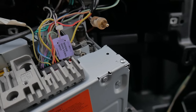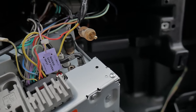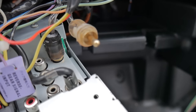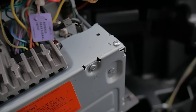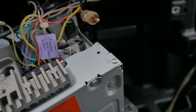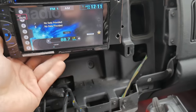When it switches to the reverse cam, the actual video signal runs through your RCA to the back of your radio — that's how you get your display. So just one wire and one RCA. The RCA on mine is labeled RC in, which is rear camera in, and then the wire is reverse gear signal input. Put both of those to the back of your radio and it'll allow you to get the display that you need.